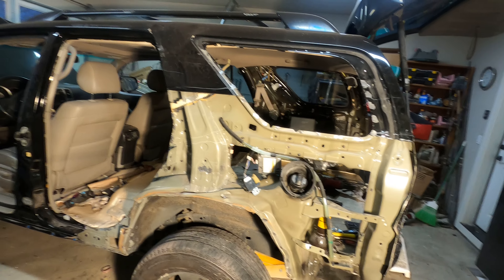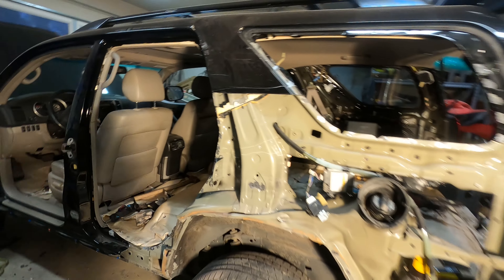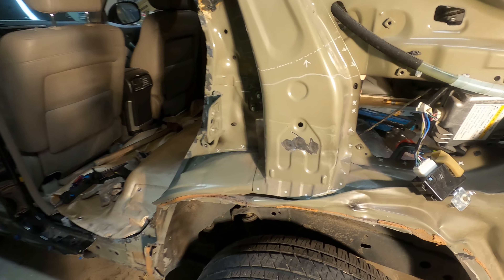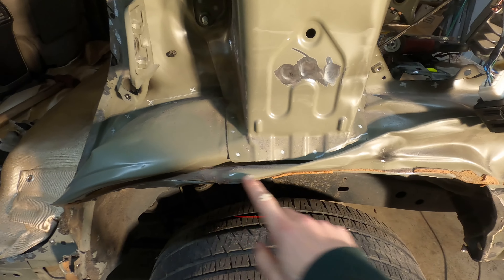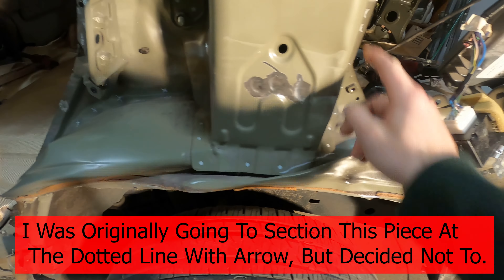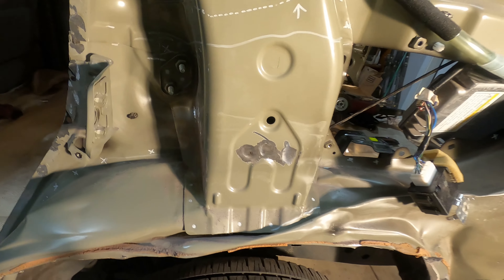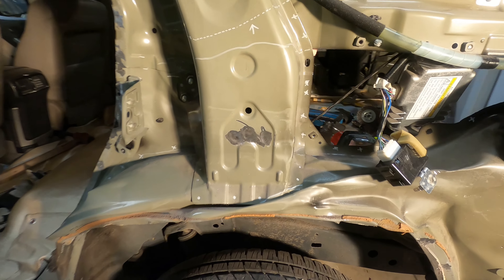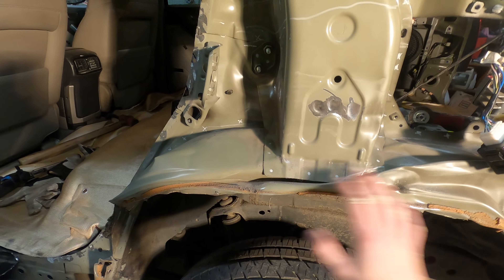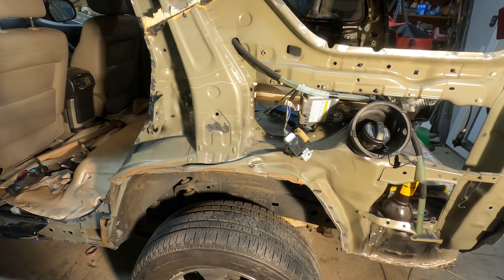Something you guys need to know about me — I change my mind a lot when I'm working on something. If I find a better way to do something, then I'm going to do it that way. This little piece right here, I was doing more inspecting and it's not really that damaged. It's a thick piece of metal and it's strong. It got crumpled and stuff, but for the most part this actual piece is pretty solid. So I'm kind of glad I didn't start taking it off. I could add extra welds to make it stronger if I have to, but what I'm going to try to do is keep this whole section and just take this piece off from underneath it. I'm going to have to drill these ones out and try my best to keep this in one piece.